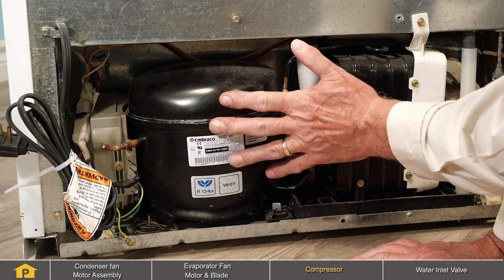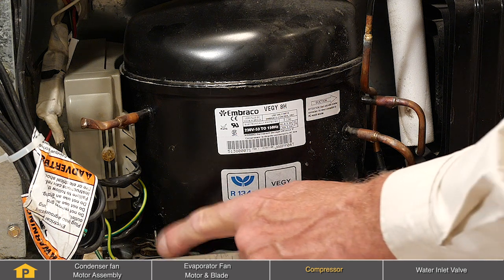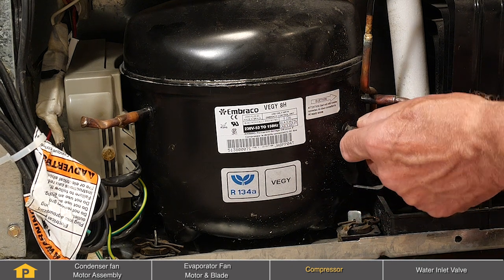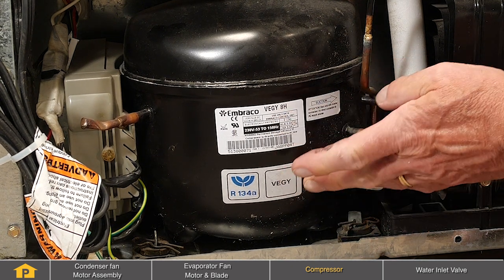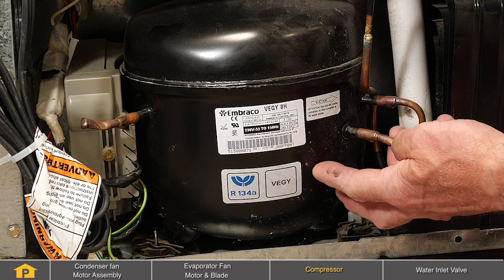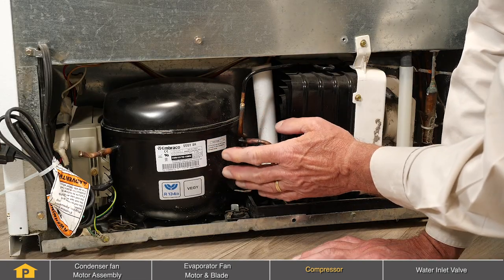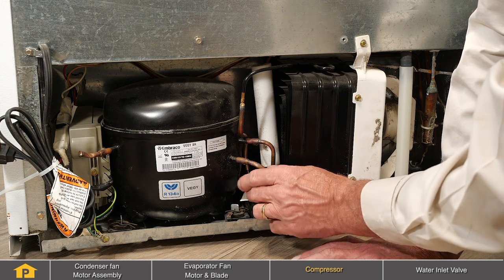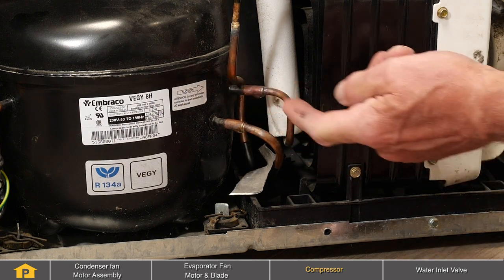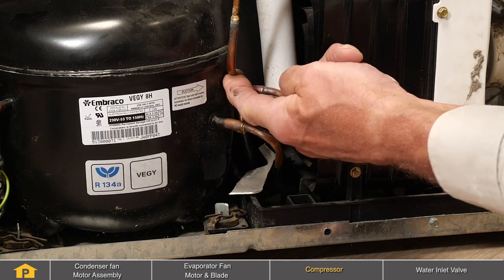With the access panel removed, you can now see where the compressor is mounted. A couple of things we want to verify: first, that the rubber mounts on the bottom are intact and not damaged. A knocking sound that occurs once when the compressor starts and again when it ends would indicate a defect inside the compressor with the suspension springs. To replace the compressor is a fairly expensive repair, and if the noise is not too intrusive, you may wish to just leave it. You'll also want to check the tubing around the perimeter — make sure nothing is vibrating, but if you need to move any tubing, be careful not to cause any kinks or sharp bends in it.